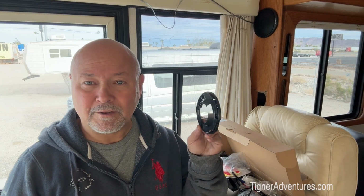This is a wired system, which, if you watched my video on our backup camera, we used to have wireless, but there are so many issues with wireless that it's just not the best way to go. And our other system that's in Beulah, our other motorhome, is a Blink wireless system, and we found out one of the issues with that: if you don't have internet, it does not work. So unless you're parked in town, pretty much it doesn't work. And then if someone cuts your internet, or if your internet goes down for whatever reason, you have no security anymore. You can't look at anything on your cameras. Even if you're sitting right next to them, it won't let you do that. So today we're going to mount these on there and drill holes through the rig and run the wires everywhere.